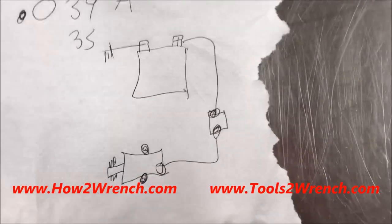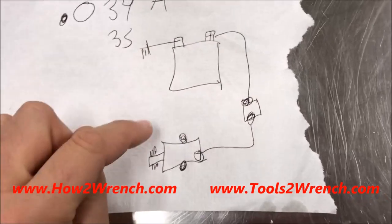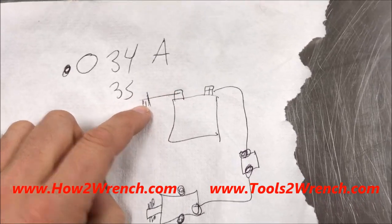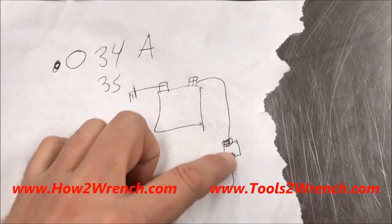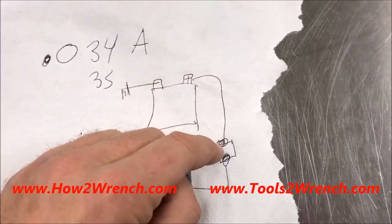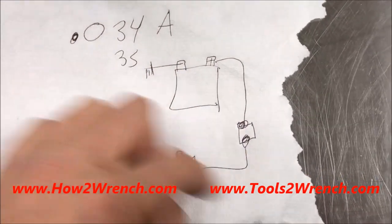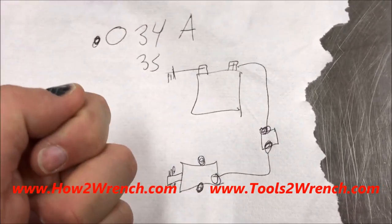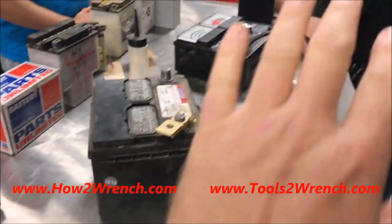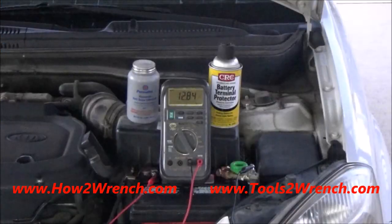Here's why it's such an advantage to use the starter as a load test. If you think of a basic system and look at all the connections — you have the battery negative, a connection there, a negative on the chassis, the positive to the solenoid, solenoid to the starter, and the starter itself to ground — that's seven connections. You get to load test all seven of those just by using the starter and the key, testing the integrity of all of them, versus a standalone battery load tester which only tests the battery itself.